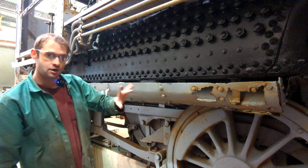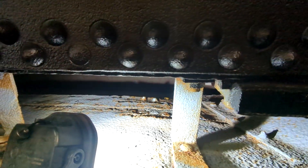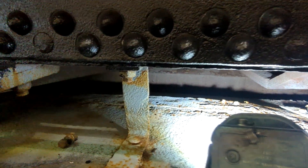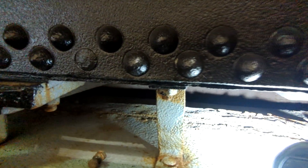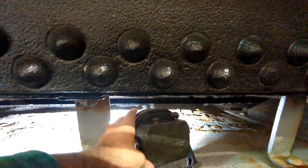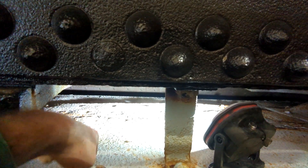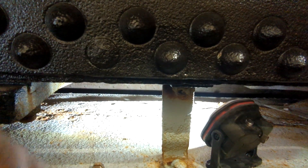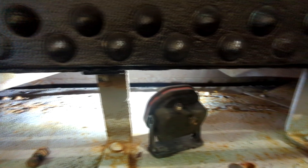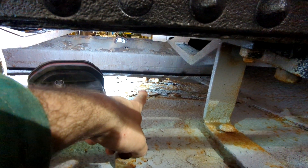On the other side I left two nuts as the very last ones to remove that were holding it in place. Something I'm starting to see more frequently is previous repairs that I now have to deal with when taking things apart. On this one you can see there's actually a separate wrapper sheet that they used to join the existing pan to the back of the pan — it must have rotted through at some point. The other side didn't have that. I'm going to have to figure out exactly how it's held down; I can see some nuts and bolts in the back, so I'll go after those first.